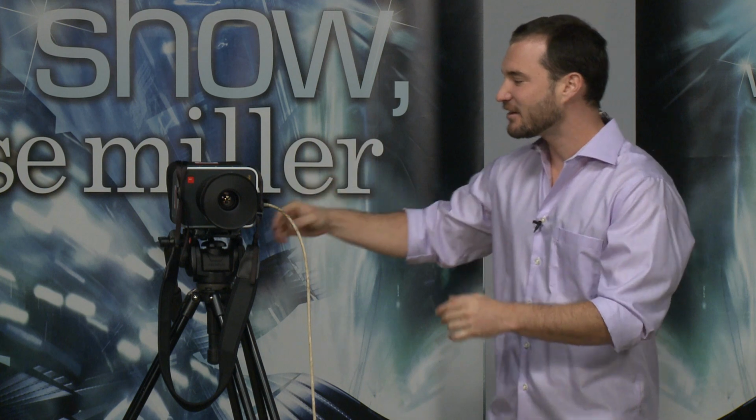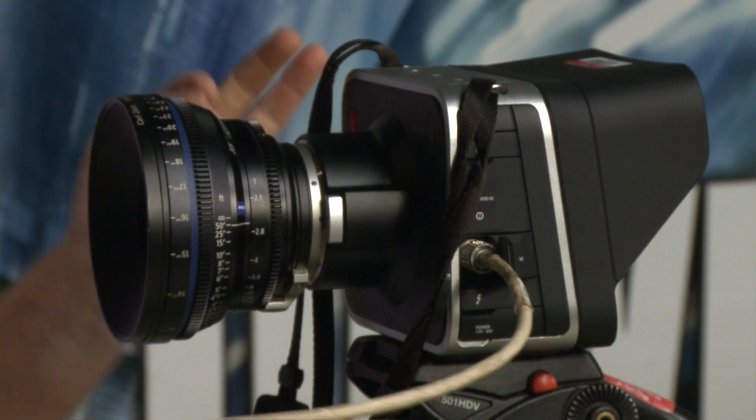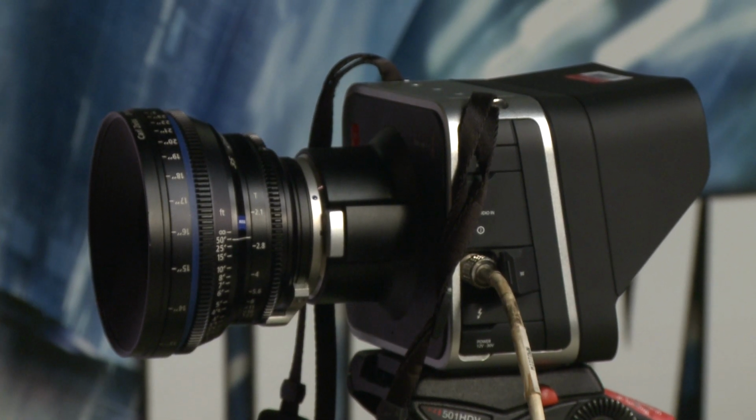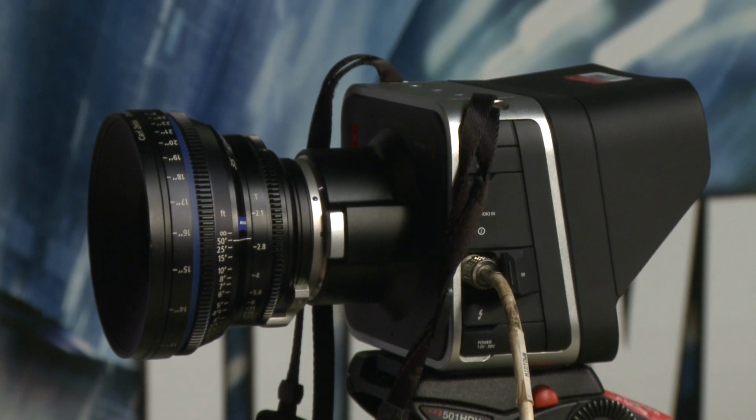All right. Let's take a look at the side of the camera here. All of the connections of the camera are in fact on the side. Okay. One thing that you'll notice is HD SDI. Fantastic, right? You might think to yourself, broadcast connection, excellent. But I've got to stop you there. Before you go buying 12 of these to put them into a multi-camera production, I want to caution you, make sure your multi-camera production will be progressive, because there is no 1080-60i out.